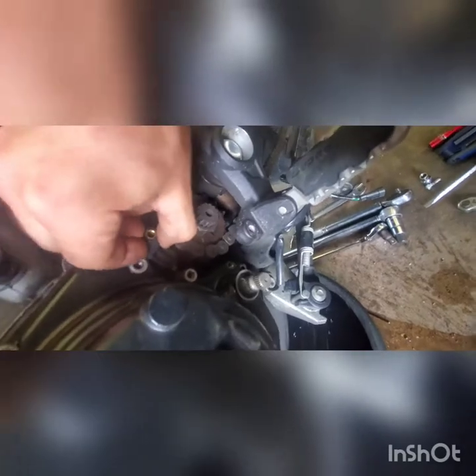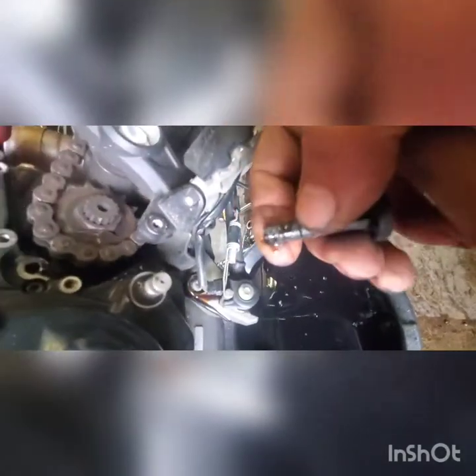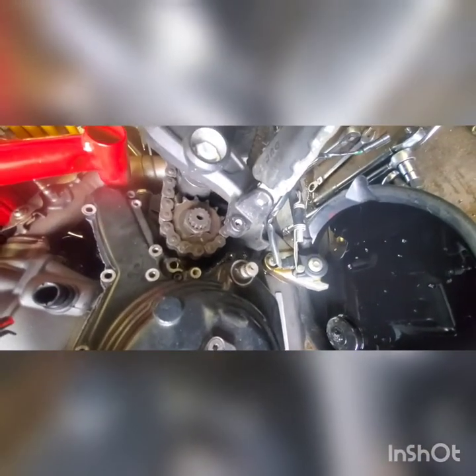I've got some collapsible bolt containers here. If you're not very good at figuring out where the bolts go you can reference the manual or set them up and back in there. Now there is a small alignment dowel with an O-ring on it. You will have some oil come out so make sure you have a drain pan to catch that. You'll have to make sure that hole is clean when you go to RTV everything back together. There's a bolt there and a bolt there to remove the cover — those are five millimeter.